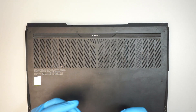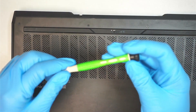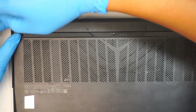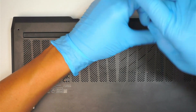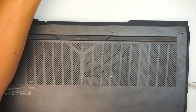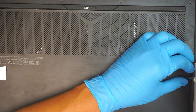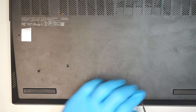The first thing you need is a Phillips screwdriver — this one is a lot smaller, so I'll be using the 1.5mm. Go ahead and remove the screws starting from the top left corner. The screw is a lot longer as you can see. What I recommend is to take a picture of your laptop and print out that piece of paper. As you remove each screw, place it on top of the printed paper so you have a reference knowing which screw goes where and can put them back together later. The screws at the bottom are a lot shorter compared to the rest.